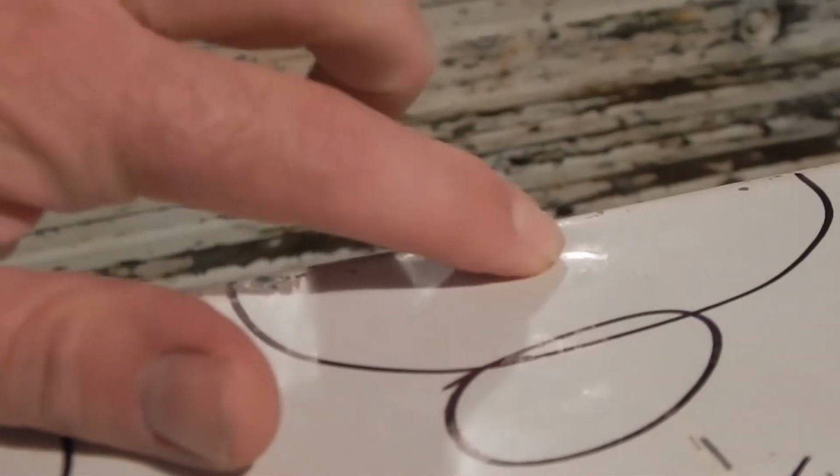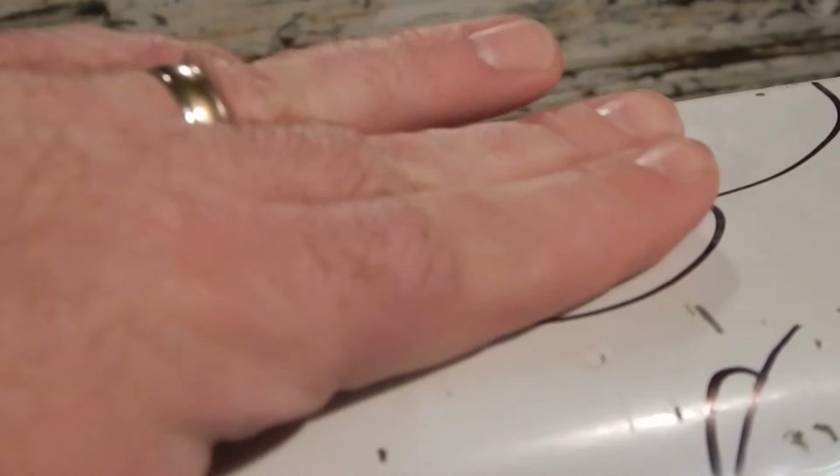But these right here, those are two that we're going to have to be able to raise that metal up so that we're not filling that whole thing, top to bottom. This thing's probably close to a 1/4 inch below level at the deepest point of that. And we definitely don't want a 1/4 inch of filler, especially in something no bigger around than that is. That's going to be a lot of filler in a small area, and it will absolutely get knocked loose when we're using this pickup. So we're going to knock that out.